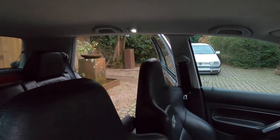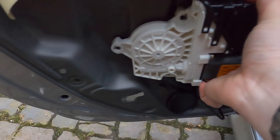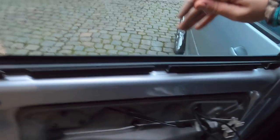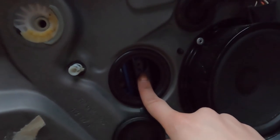She's going down. Did you hear that little breaking noise? I don't know what that was. Once it's unplugged, you can just go ahead and wiggle it back and forth. Now with the regulator off, we can go ahead and just push the glass down so that it lines up with this little hole. You can see right there — that's like a little spreader plug. So I'm going to have to get a 6mm screw, screw it in, and then I should be able to pop it out and pull it past the little cable.